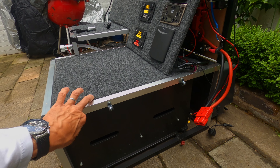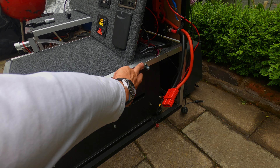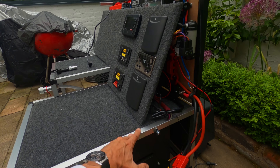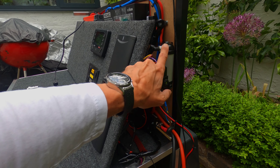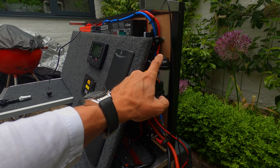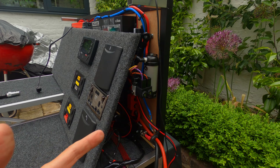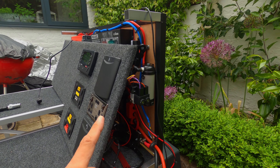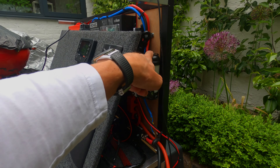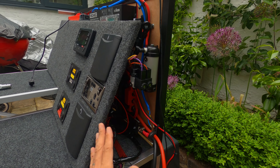Until this goes in I'm going to have to run the airlines. I think I'll put the compressor on the side here with two rivnuts and run the airline through here. I also have an auxiliary chamber — this is for the ARB controller. You set a pressure up or down and this controller will automatically inflate or deflate depending on what you set from an app. I've had it for a while but never put it in the old one. Because this is sitting flush, you won't see this — this will stay open.